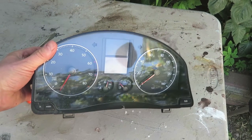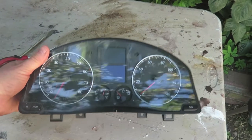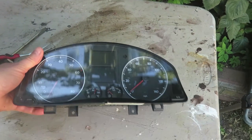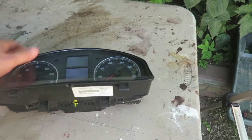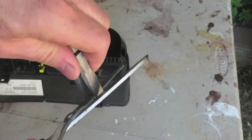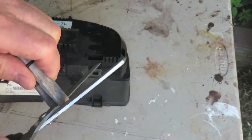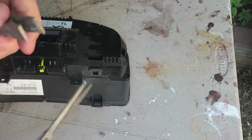For starters, what I've done is bought an old speedometer unit — or instrument cluster, as they're officially called — from a scrapyard, one that has kilometers instead of miles on it. I'm going to transfer just the printed unit from one to the other. Unfortunately, replacing the whole speedometer unit intact isn't an option in most cars because you would have to recode the CPU to recognize a new speedometer unit.